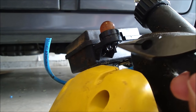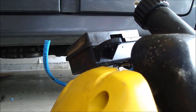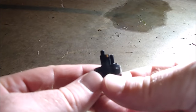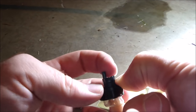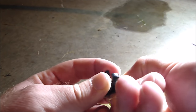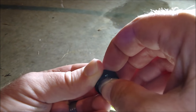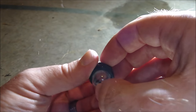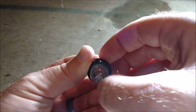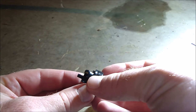There's a tab here — you can push on it and it'll pop that up. Another tab on the other side, the same, and it pops out. Okay, so if you forget which side is suction, you can just push in on the bulb and then put your finger over one of them. If the bulb has a hard time coming out and when you remove your finger you can feel the vacuum release, then you know that's the suction side. Or if you put your finger over the other one and it's hard to push the bulb in, then you know that's the hose to the gas tank.